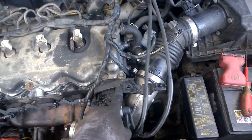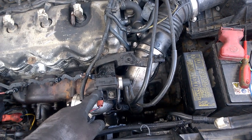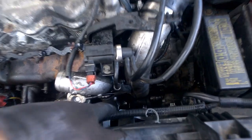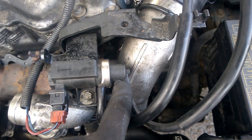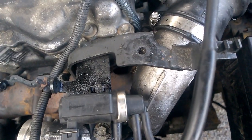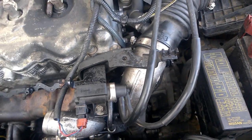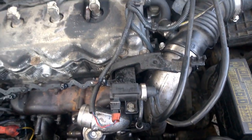Next, put on this little bracket, then your air hoses and pressure hoses. This bit here goes down into the actuator. You probably can't see, but it's labelled right in there to tell you which is which. If you get confused, take a picture beforehand so you know which is which. Tighten this up and then the intercooler can go on next.